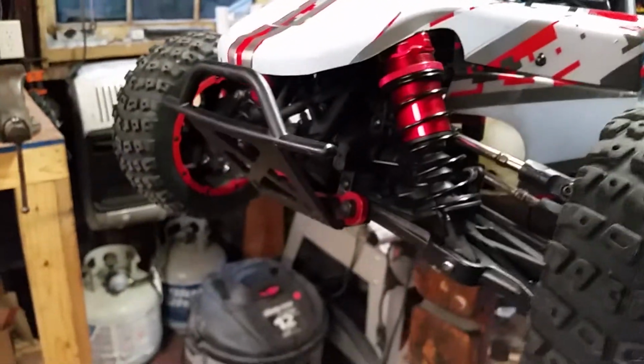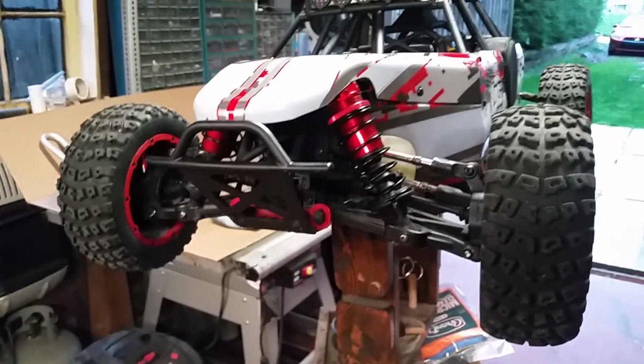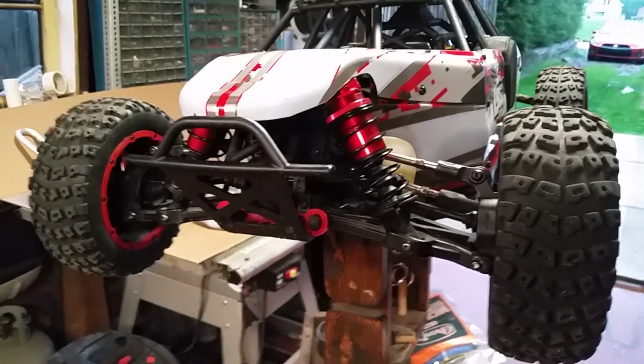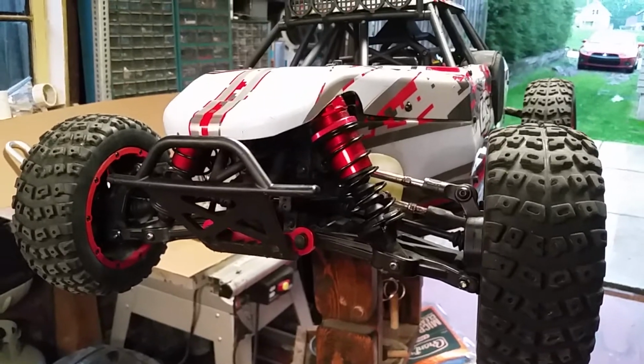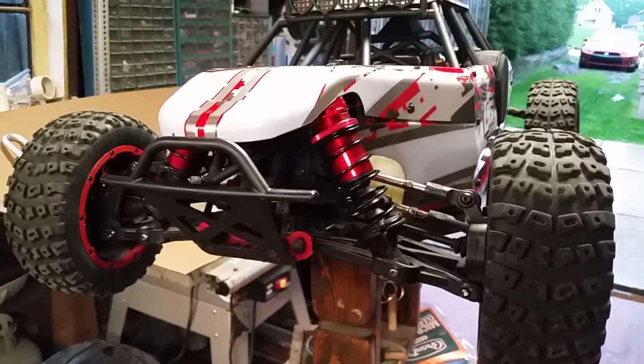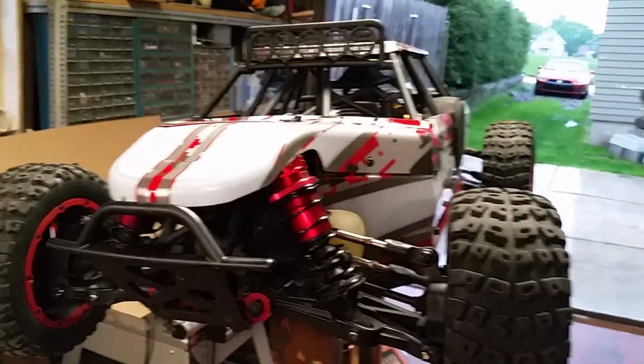Well, like I said, it was running really well today. And I also tuned this carburetor up too. I made it more rich to keep breaking in that motor because I replaced that top end. So it's really rich, but it has a lot of power still.